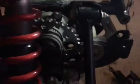And underneath here, you will see, no, you won't see because the lighting's so bad, but there is a bolt right there. Maybe I can get it from this side. But right in there is a bolt right where my finger's touching. That's the bolt for what would be known as I guess a swing arm on a solid axle bike. So loosen that guy up, loosen this guy up right here where my fingers are touching, loosen the bolt up that came through there. I highly suggest doing that while your jack is underneath there.